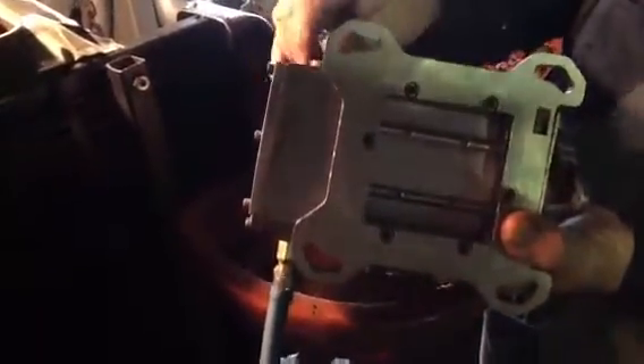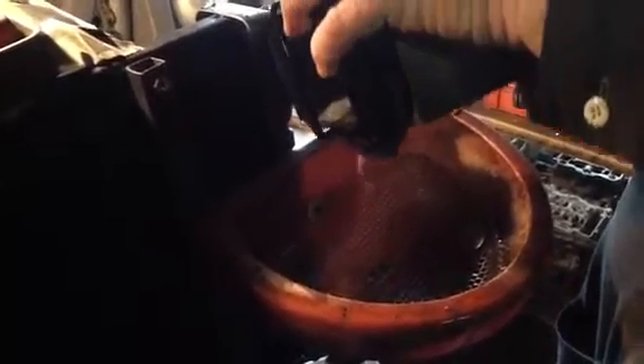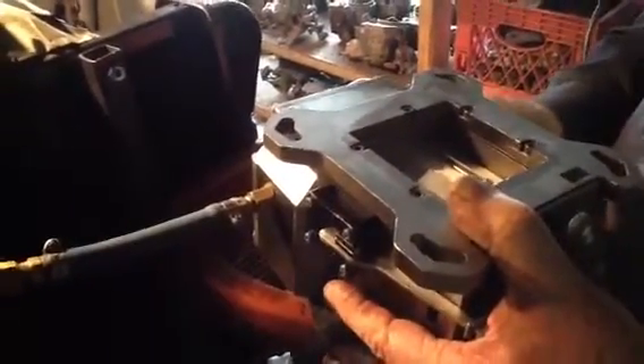I'll show you one more feature that the Predator has that no other carburetor has. These are good for mud bogs, hill climbs, off the road, rock crawlers and all that. You see that? That's just the gas that was in the line — the rest of the gas is still in there. To get it out, you gotta take this plug out right here. There comes your gas. On the other style Predator, you have to actually take the gas line off to get the gas out of the inside.